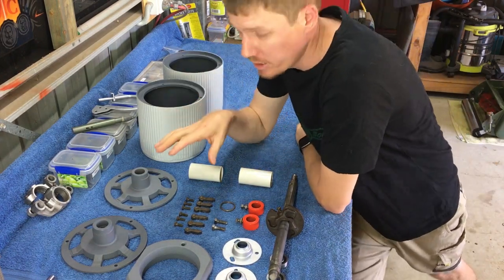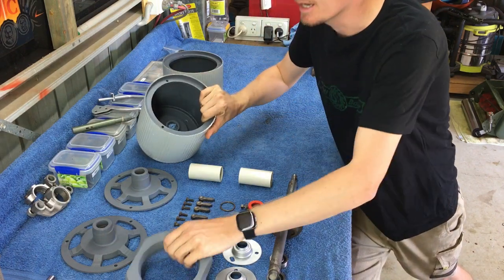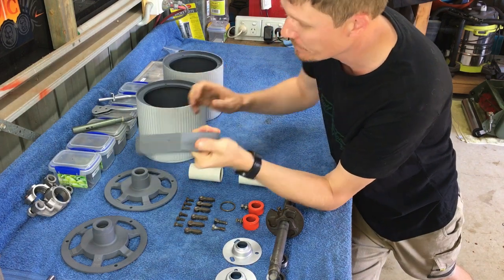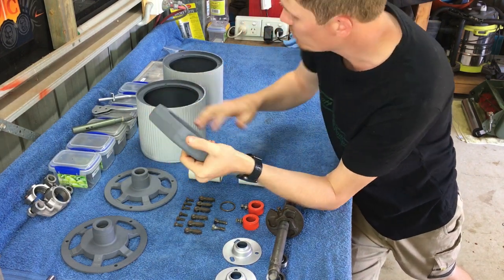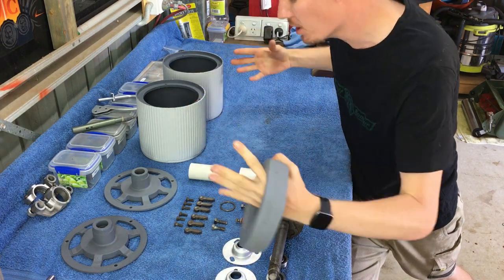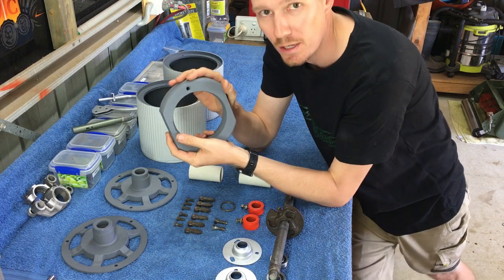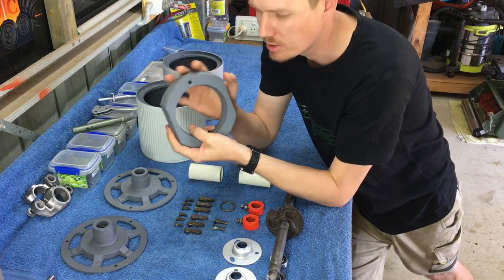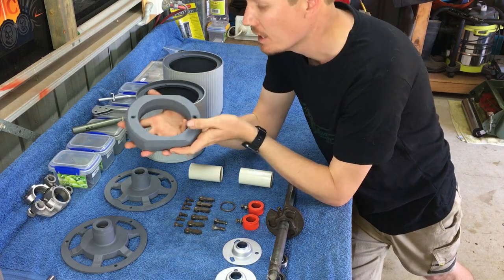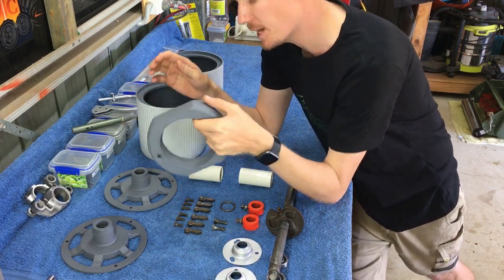Because this is a 14 inch model, it actually has a counterweight installed inside one of the rear roller halves. It doesn't actually matter which side you put it in when assembling the roller, but once you put the roller together it does matter - the counterweight has to be on the non-drive side, so basically the opposite side to the chains. That's pretty crucial.